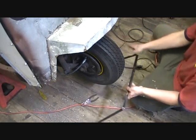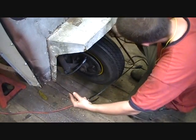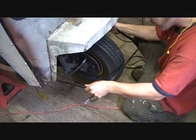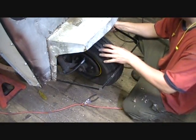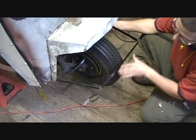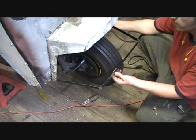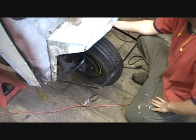I've got this bracket that I just cut, and I've got a couple of slots. It's a little tricky to get in the fenders themselves. It's going to look something like this — a little more square than that, but actually pretty close to the wheel. I fit my fingers under there — it might be just a hair out from that. No contact there, no contact at full turn. Although it is close. After this is welded, or at least tacked in, I think I'm actually going to end up bolting it so I can take it off when I need to do work. I could always take the panels off because these are going to be sheet metal screwed in.